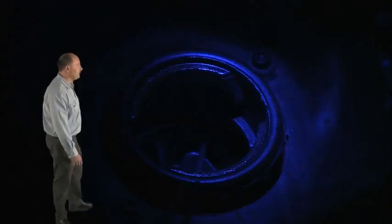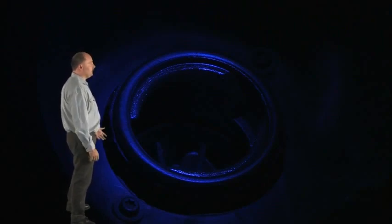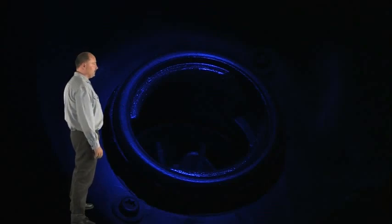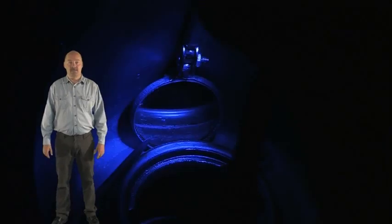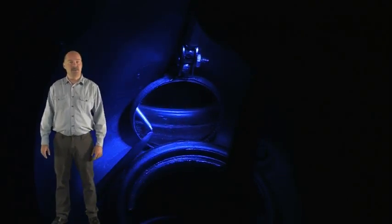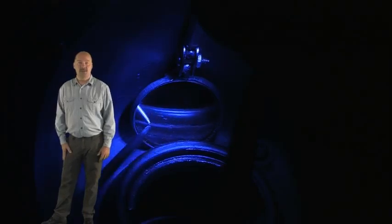Remember, this cap is better in place. Using the black light and looking closely at the sealing point of the cap, you can see the dye is only on the inside of the sealing area — this means the cap is doing its job. This filler neck uses a plastic cap locking mechanism inserted into the metal pipe; the cap seals to this plastic insert. When we look very closely, it is clear a leak is coming from between the plastic insert and the metal pipe.